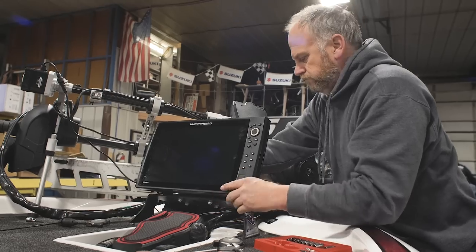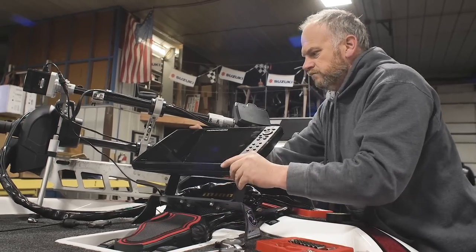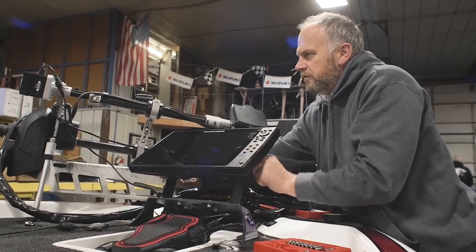So you just have to re-clock that. It's a super simple, easy, quick adjustment. Another nice feature of Dave's is it's simply adjusted by loosening up, and you can adjust the shaft length on the unit. So let's say you're fishing shallow versus running your propeller into your Mega Imaging or your Live Imaging, or whatever imaging you've got going on.